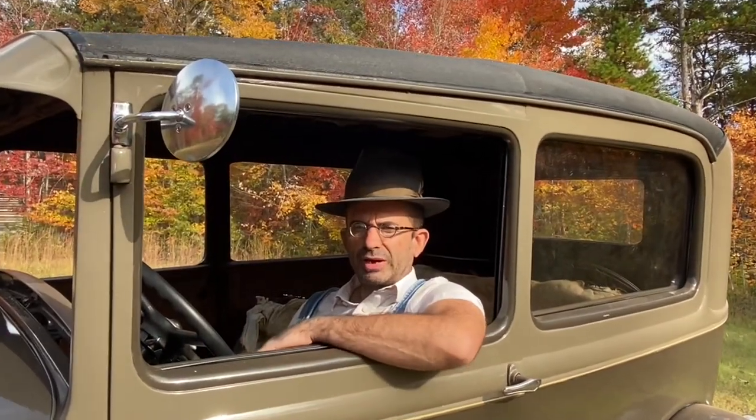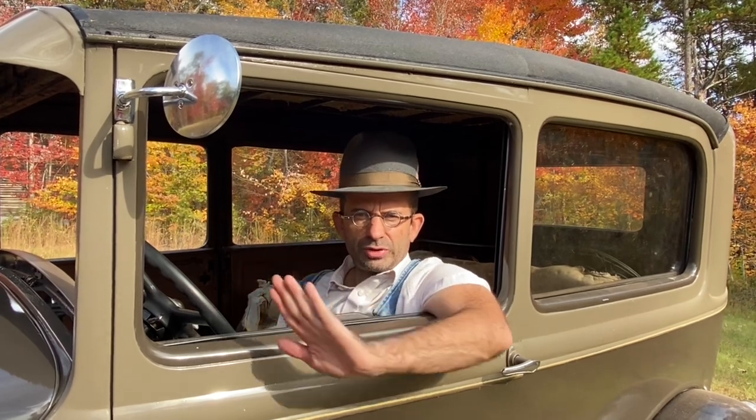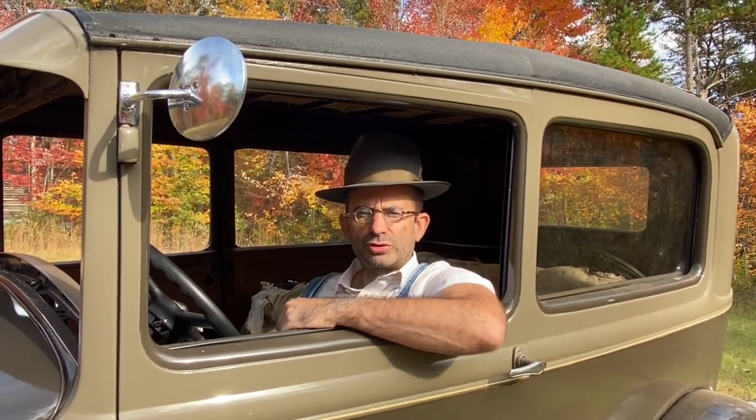The gentleman I took my gas tank to actually cut two holes in the back of the tank — that's the side that faces the firewall that you never really see. He cut two circular holes in the back and was able to clean more of the baffles out inside with those two holes. Then at the finish he welded both of those holes shut and used Red Coat — tumbles it around and it completely coats the inside, and it should be ethanol-resistant.